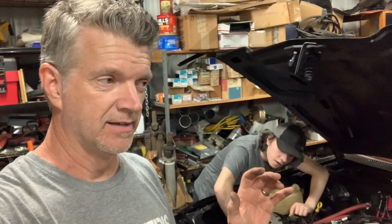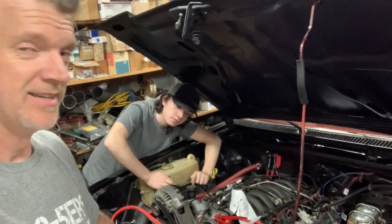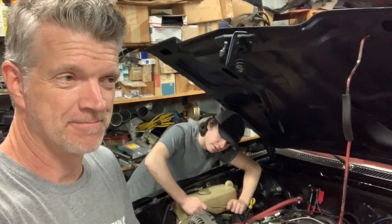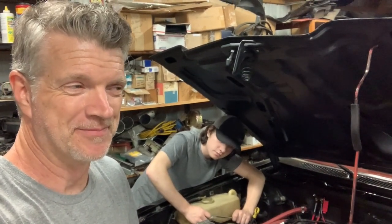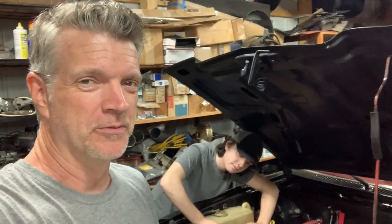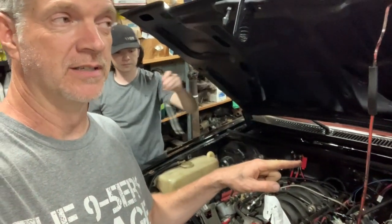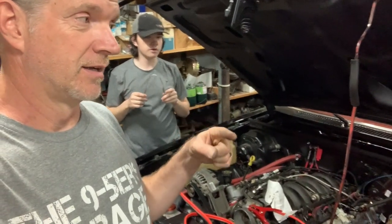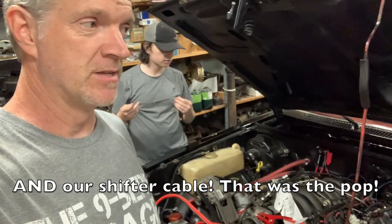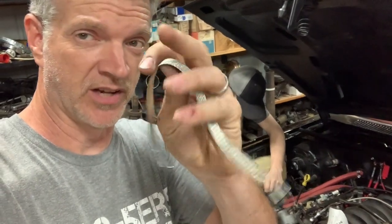We're a little embarrassed. But what just happened? Essentially, our engine wasn't properly grounded. The car ran, and you missed it. We realized that we forgot to put a chassis ground to the engine block. I'm lucky we didn't burn up the ECU. The entire ECU was grounding itself through one tiny little wire. It was trying to ground the entire engine through the teeny little ECU wires. So we're going to fix that now.